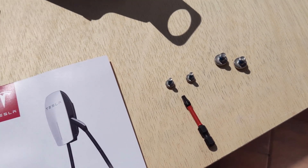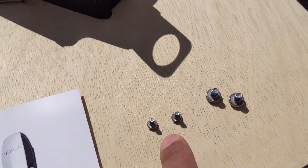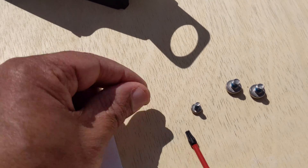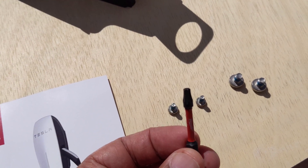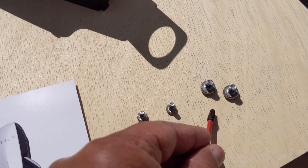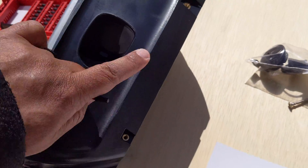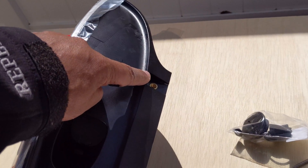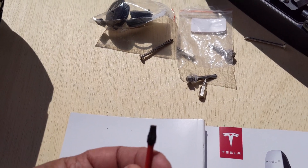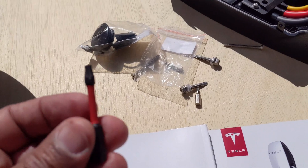Next I'm going to install the unit on the bracket. You're going to have two screws — a big one and a small one. You'll need a T20 bit because these are special nuts. The small screws go on the bottom and the big ones go on top, corresponding to the two screw points on the bracket. Get yourself a T20 and they'll attach the box to the bracket.